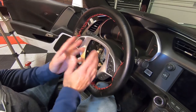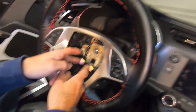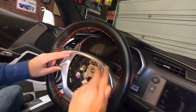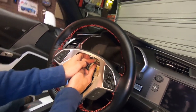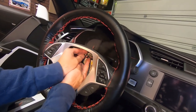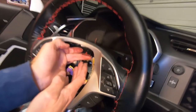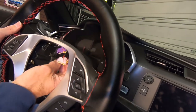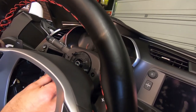Now that we finally got the bolt out, you can see it's free. What we want to do is disconnect the main circuit plug for all of your control buttons. There's a little tab right here that you press in and you pull that one completely out — it just comes loose. At that point you can start to pull the steering wheel free, and the hole that the big plug was taking up — your airbag lines can actually go right through it.